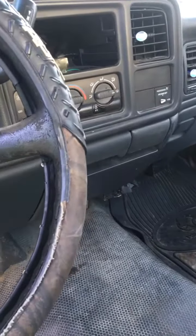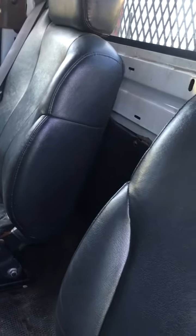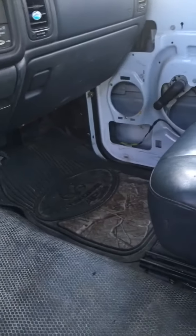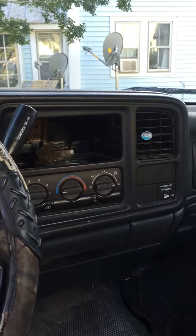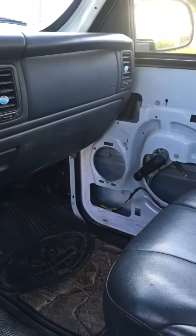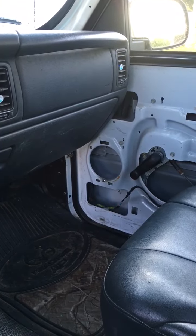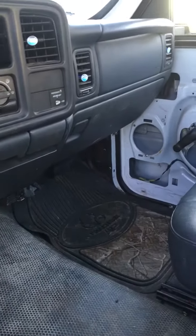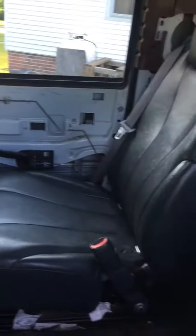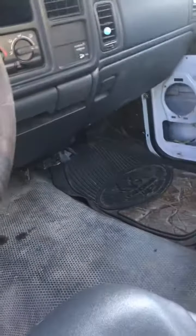I want to have a custom center console box running front to back, probably be fourth order, with my Twisted Sounds 3.5k power in it. I also got a JVC deck that will be going in there. Bluetooth mids and highs — just gonna replace the factory for right now and kind of see if I can get away with that. If not, I'll have to add more mids and highs because I want it to be clear and loud. I'll be pushing the mids and highs with the Twisted Sounds 150 by 4.